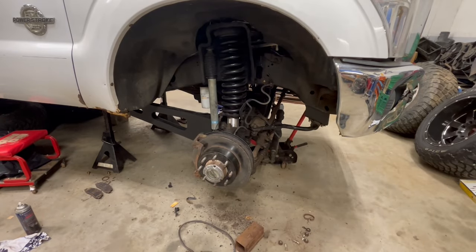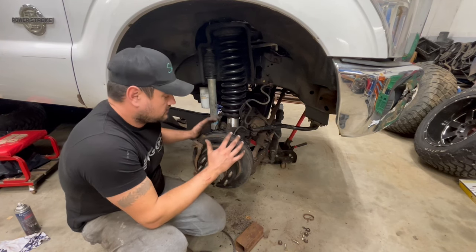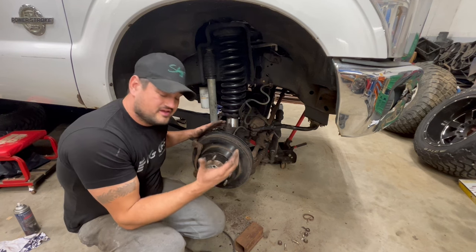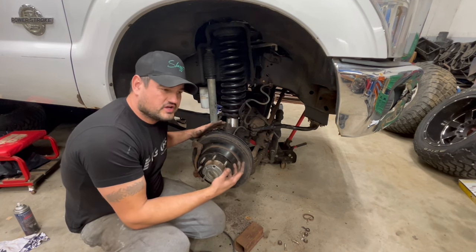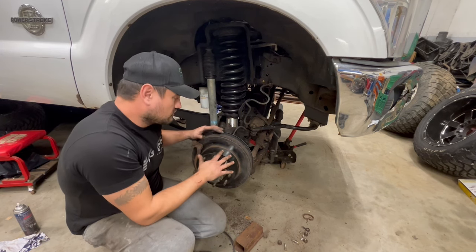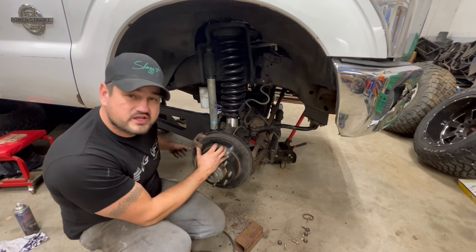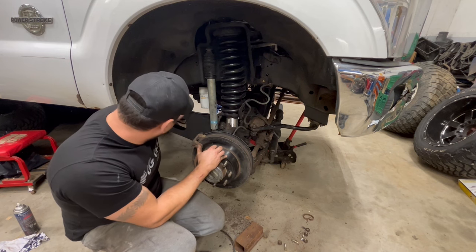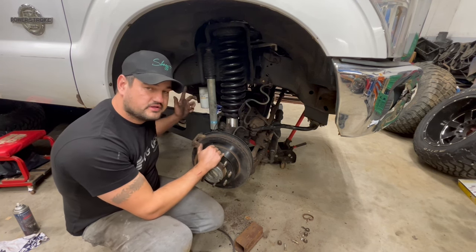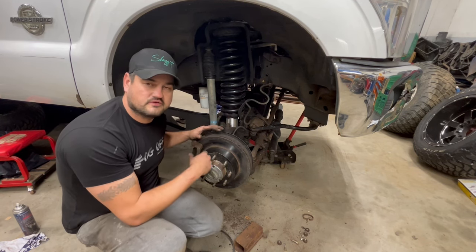Got the brake bracket back on, rotors back on, dust shield. The dust shield was giving me a little bit of a hard time. I should have replaced that when I put the bearing back on - I did notice at the time it was in rough enough shape that I should have replaced it. If it ever comes back off again, I'll replace it then. The rotor where it was sitting for a little bit had a little rusty crusty on it on the inside and outside. I cleaned that up, and the radius arm I spray painted just to make it a little bit pretty. And I ran the ABS sensor wire - just got to tighten that up. Dielectric grease in the plug - that's a big thing up here in Canada. Salt gets in there and gives you fault codes and traction control issues, and you don't want that.